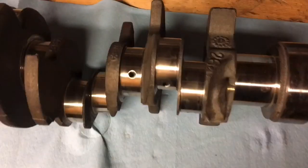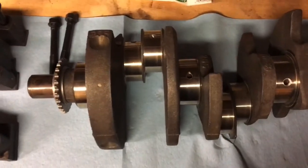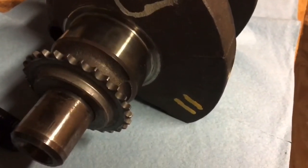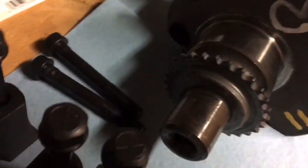The crankshaft is here. It's been machined and saved by a machine shop. If you look at the front of it, it says BAP — that stands for Benning Auto Parts. It's got two yellow hash marks right there indicating that the rods have been turned 20 thousandths, and there's another yellow mark somewhere on the mains.